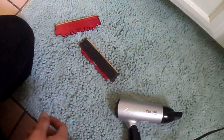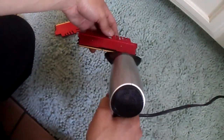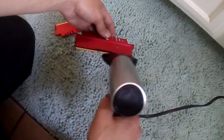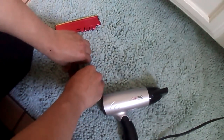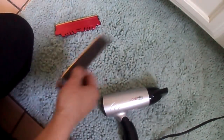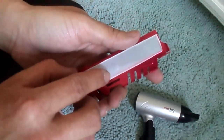This one I didn't hair dry enough — you saw it just fly off. The more you get it heated up, the easier the heat spreader will come off, so I'd suggest heating it a little bit longer. Same process on the other side: on high, a hair dryer should only take about 10 to 15 seconds for it to get warm enough. As you can see, there's no residue left on the RAM stick, which is pretty nice.